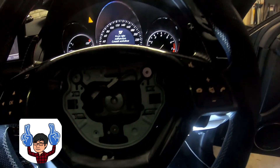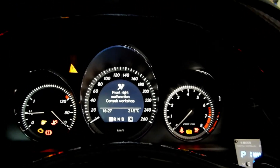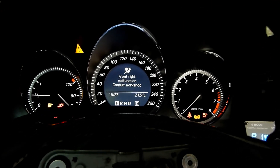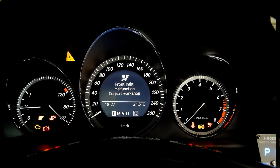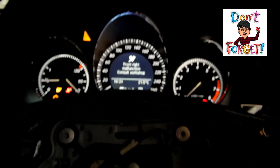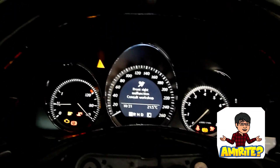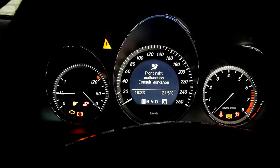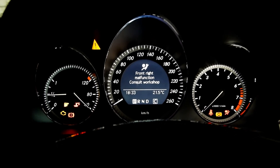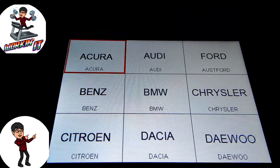Now we're going to clear it with our OBD2 scanner and I'll show you just how easy it is to clear an airbag code. Don't do this at home unless you have your own OBD2 scanner, because just reinstalling the airbag won't get rid of that code — you actually need a tool to clear it. Before we get started, you have to reinstall the airbag first, because there's no point clearing the code unless the physical problem is rectified. Now I've reinstalled the airbag, turned on the car, and as you can see I still have the airbag fault. I'm going to show you we can clear it in real time.